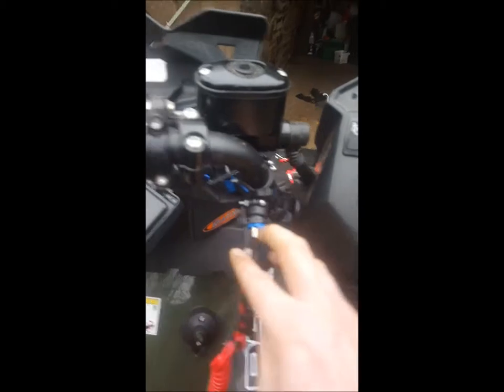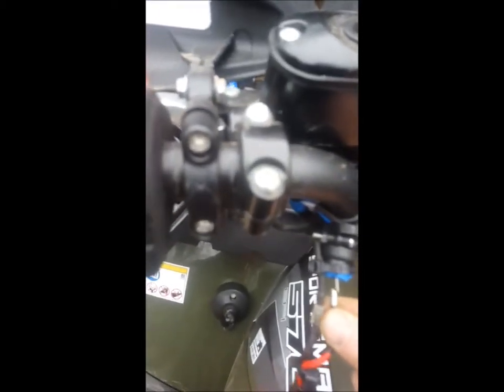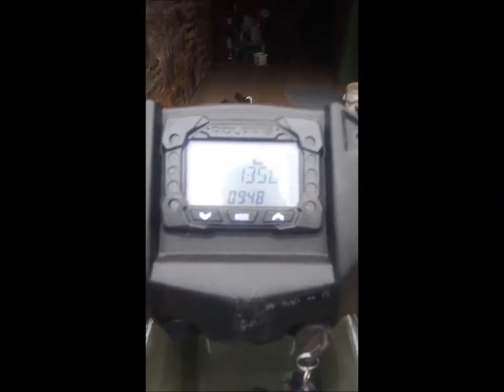And that's all you need to do. Reconnect your holder for the kill switch to the handlebars. With it in, you should have the vehicle firing up as usual. So we've got it running. And the nice thing is, because this is a dual connection — you've got a loop in your wire so it completes the circuit — you can pull any one of these out like so, and it shuts the bike down straight away. Once you pop it back in again, it fires the bike into life. Taking it off blanks the screen off — you're breaking the circuit. I'll fire it up again. There you go, the circuit's in place. The bike is running between 1250 and 1350 idle, as it should do.